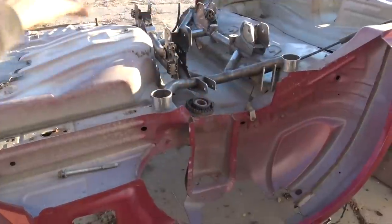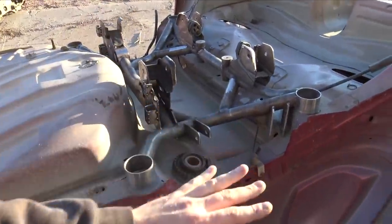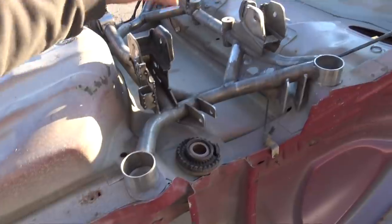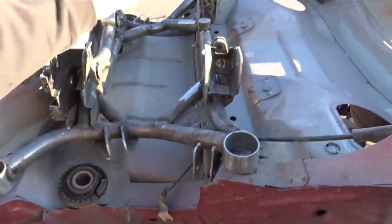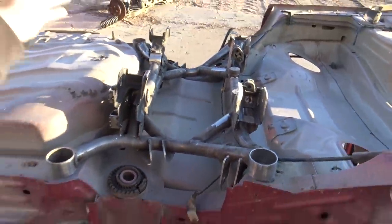So the rear subframe, 100% fabricated. We have the sway bar mounts, lower control arm mounts, all the suspension mounts for the adjustable arms, diff mounting, exhaust mounting, parking brake mounting. She is finally ready to weld up. So I'm gonna end the video here just because it's gonna be a lot of welding. And I'll do that in the next video, which will probably be this week as well.